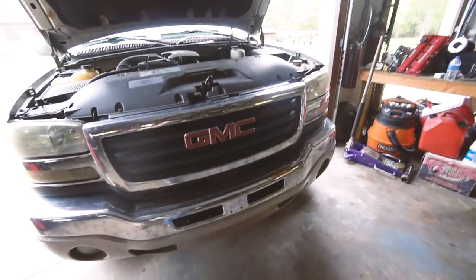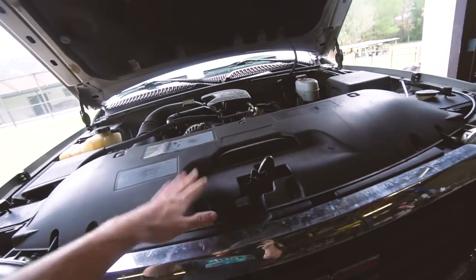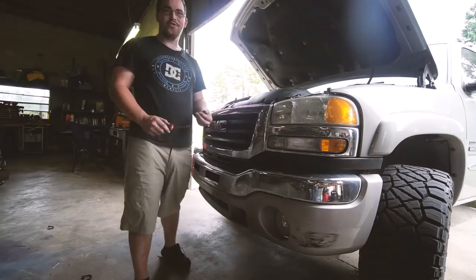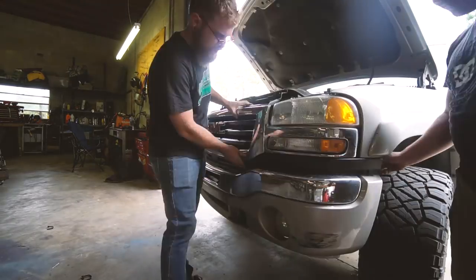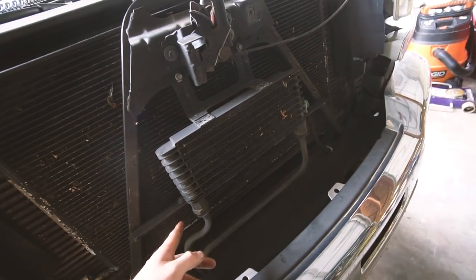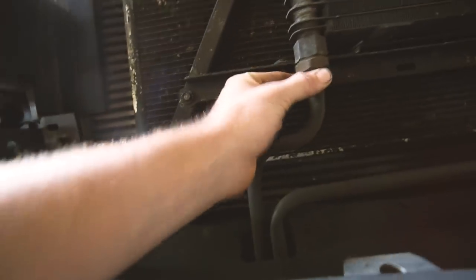Kind of a scary sight — got my truck in here. I'm about to tear it apart and make it undriveable. And then my vet is taken apart and undriveable too. I think the first step is just rip the grill off, try not to break any of the clips or break it. Then we'll have access to the trans cooler. This is our factory trans cooler — obviously very, very dinky and tiny. Looks like our new one mounts to about here. We're going to start taking it apart, so fluid will come out. We got to figure that out. We got to get these little clips off.